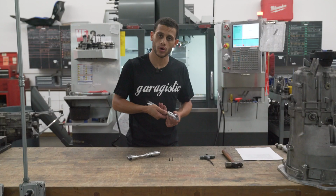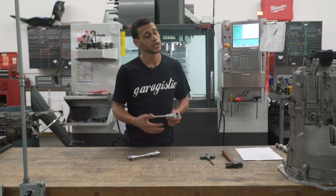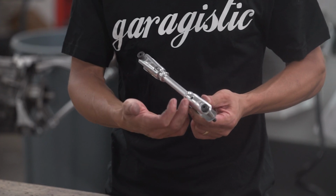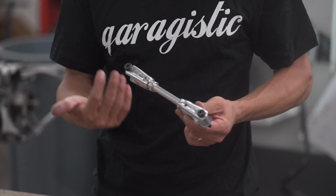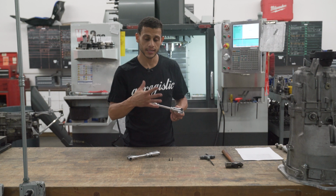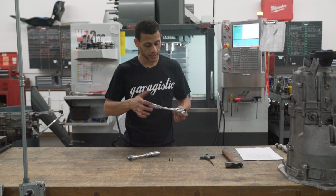So you're definitely going to want to get this adjusted before you put it in the car, or at least put it in the range before you put it in the car. It'll make it considerably easier to do. So what you're going to end up doing is first adjusting from one side, okay? And then adjusting both of them and just get it in the right range. If you have a factory selector joint and that's kind of the range that you want, I would compare it with the factory selector joint and then adjust it.